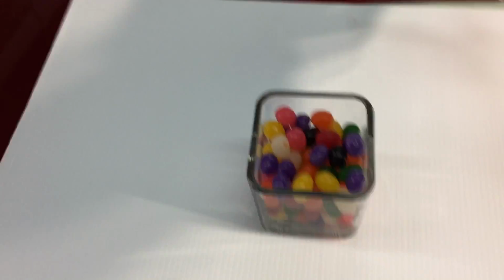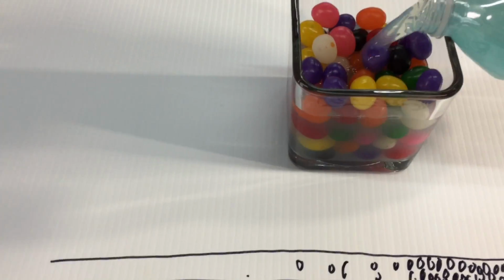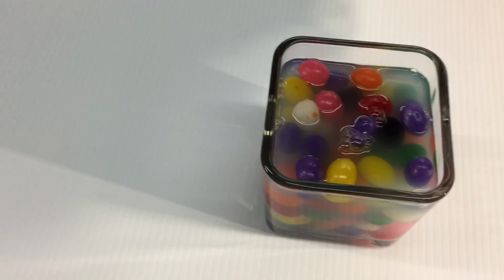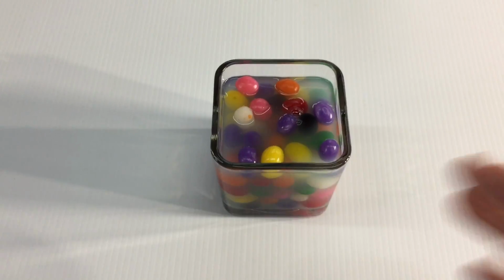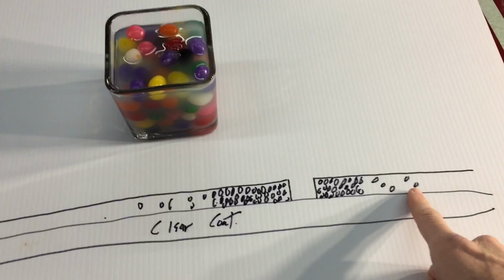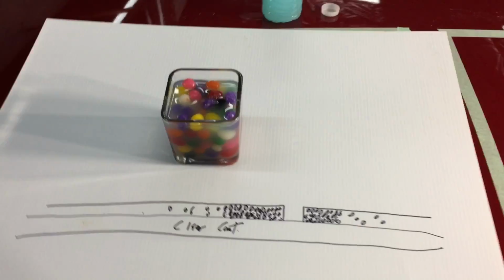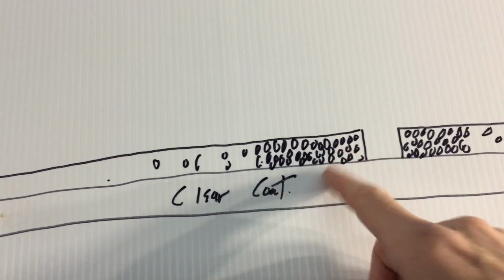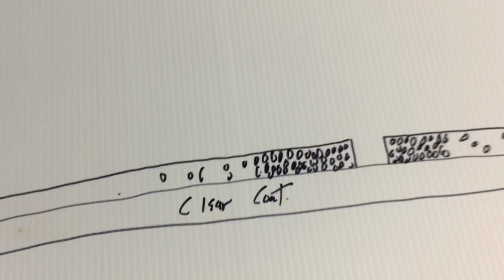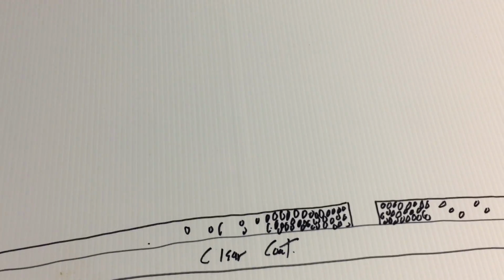And what Enigma does is they introduce nanoceramics into the equation, and that fills in the spaces between the wax molecules. And when that is spread upon a car and you let it cure and that hardens, that then creates what's getting close to a super hydrophobic layer on your car. And that's what these products do, guys. So the wax molecules are filled in and surrounded by nanoceramics, and nanoceramics are nanoparticles of ceramic, which are inorganic, non-metal, and they are heat resistant.